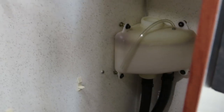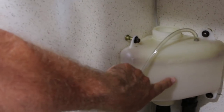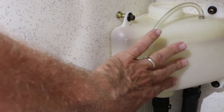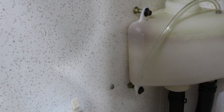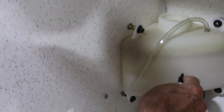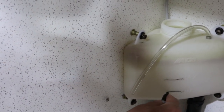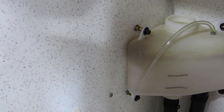First thing I want to do is take this whole contraption off this plastic shield — it just has a couple of screws. And I want to show you another little tip. You can barely see it here — that's the maximum line and that's the minimum line. So you don't want to go over that and you don't want to be under that, but it's very hard to see. So what I have done is taken a little magic marker and roughly approximate those two lines, so I know I want my fluid to be between those two levels.